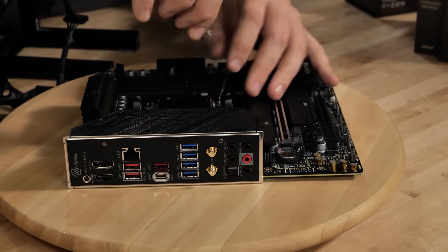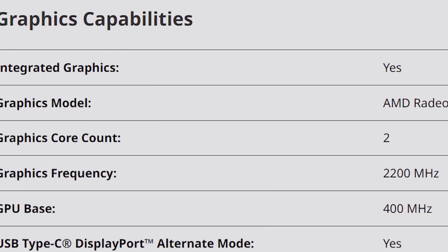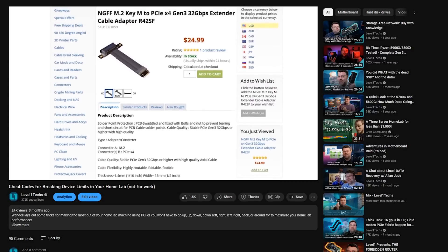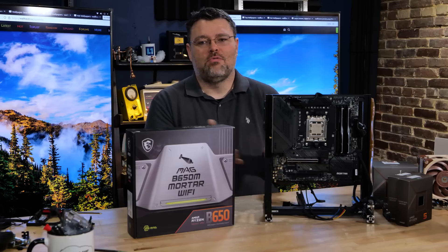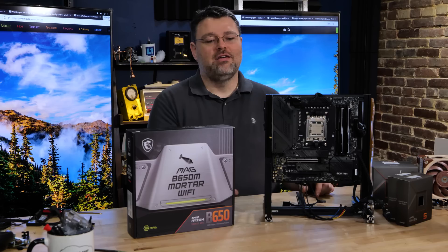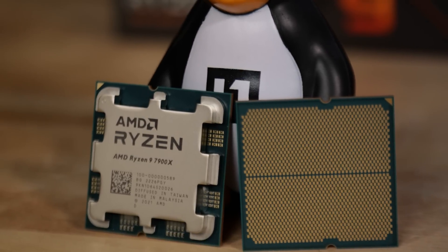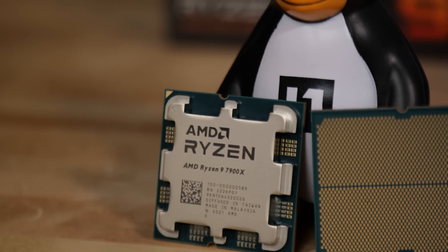For off-label uses like a home server, this board makes a lot of sense. You've got DisplayPort and HDMI out, and all AM5 CPUs have a built-in iGPU. If you want to add a second NIC including an Intel i225-V, check out home server PCIe cheat codes — you can add those via M.2 module. There are 2.5 gigabit and even 10 gigabit network cards that fit in an M.2 slot. You've got two M.2 slots, take your x16 slot, break it into four M.2 slots, and get creative. Zen 4 cores for home servers and virtualization are probably the best choice right now since you don't have to juggle multiple core types.